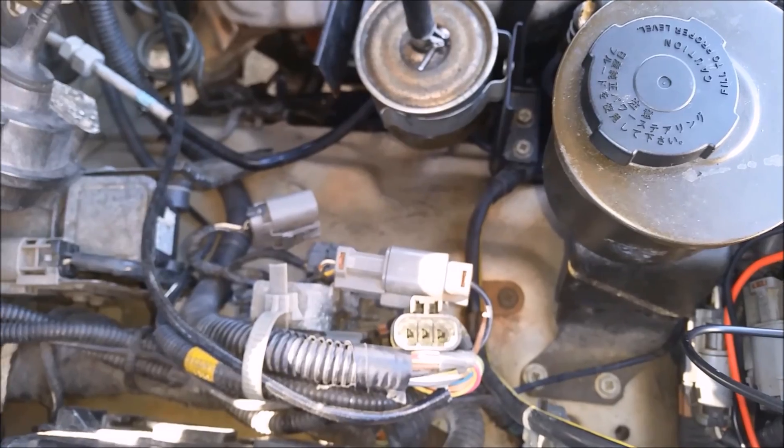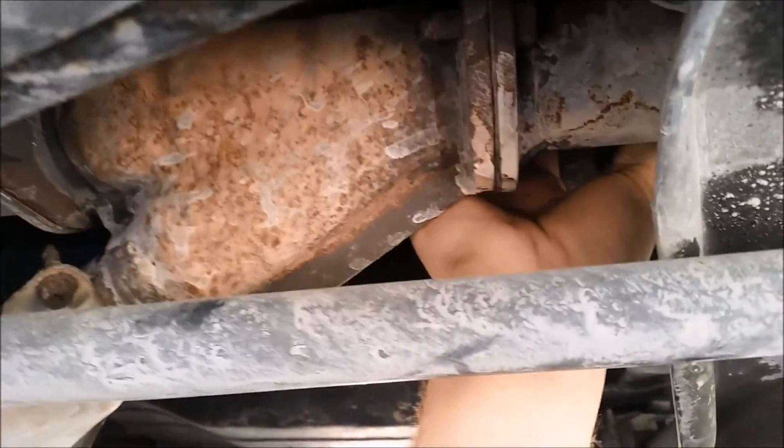On the driver side, coming up under here, there's your torsion bar, your exhaust manifold, and the O2 sensor right up in there. If you warm the car up, drive it around the block and bring it in, it'll come right off. My worker said as soon as he put the socket on there, it came right off. Use a 22 millimeter socket — the rough American equivalent is seven-eighths.